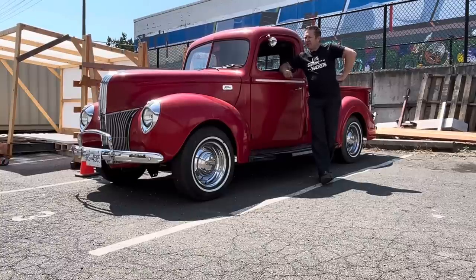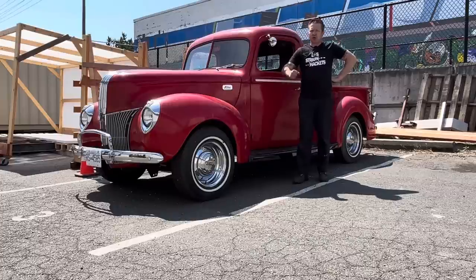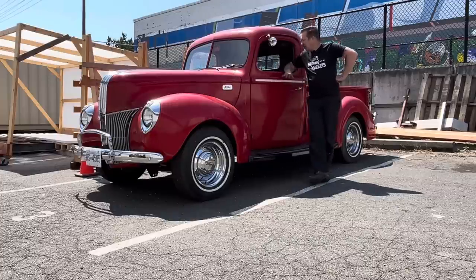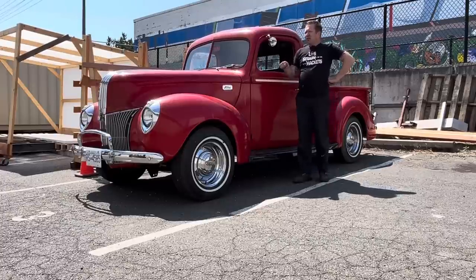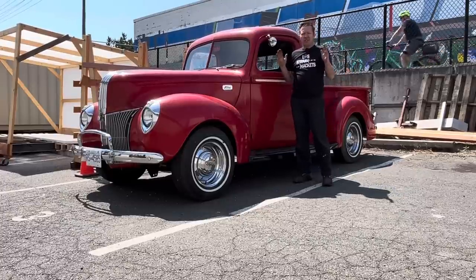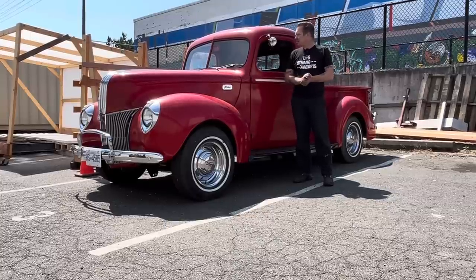So that's 5-speed, man. It's such a difference from a regular 3-speed. When you're out on the highway, it's fine. You just put it in third gear and away you go. But in town, with the speed limits, when you're in second gear, it's revving too high. When you're in third gear, it's lugging. There's the non-synchro into first gear, so there's that issue as well. And the 5-speeds just change all of that. You can go right into first gear, no problem. You've got that gap between second and third on a 3-speed, and there's a gear there that just makes it really nice and drivable.